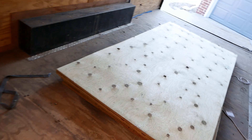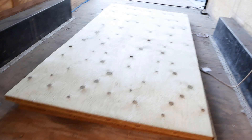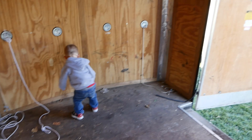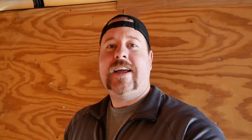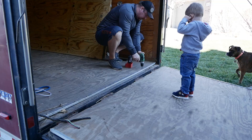One of the main things we're going to be doing is replacing the flooring. I've already got some three-quarter inch treated plywood here that we're going to be pulling all this up and replacing — it's just all rotted from water leaking through, and the boards were starting to curl up on the edges. About $250 for all the wood right now, which is kind of expensive, but that's just the way prices are going. After the flooring, the plan is to lay some E-Track down on the floor as well as a couple spots along the walls on either side for plenty of tie-down spots.